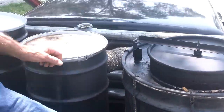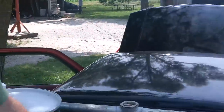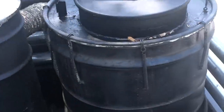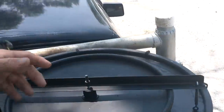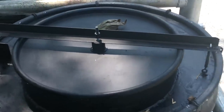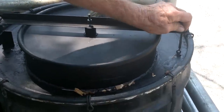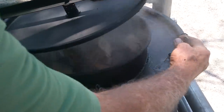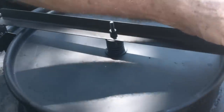It equals out to 16 pounds of wood equaling a gallon of gasoline as far as power. This apparatus is a gasifier. You put wood in here and it's sealed — there's no smoke ever seen from the vehicle. Nobody even realized we run the vehicle off of it. I'll open it just enough to show you that we do have wood in here. You can see the wood there. It smells like we're going to barbecue.